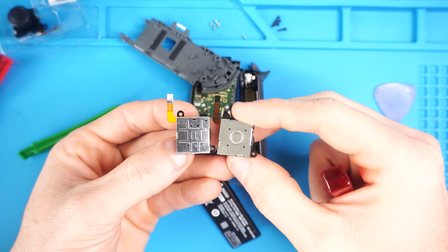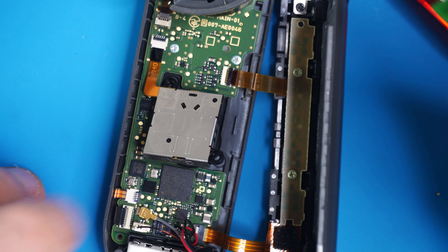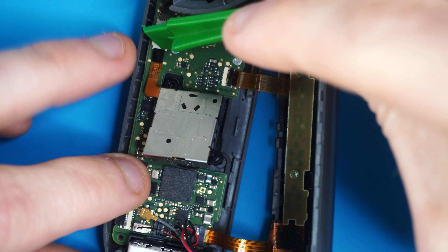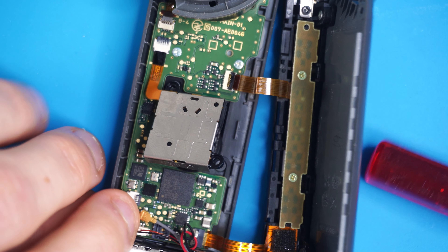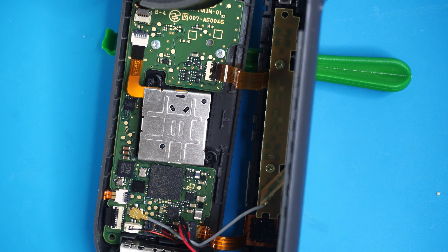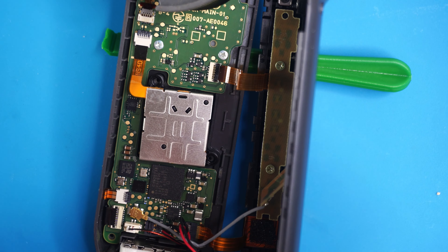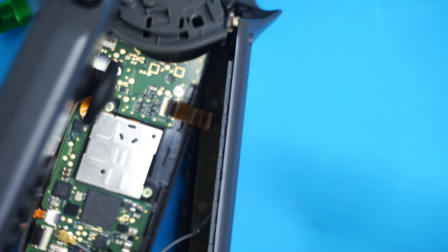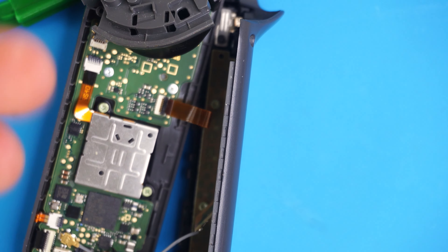Set it into the connector — there's really only one way that it can go. There's a little lip on it; push it into the connector and it doesn't go in very far — we're talking about two millimeters or so. Once it's in, push that black locking mechanism away from you to lock that ribbon cable in. Now lift the joystick up off the ground a little bit and gently place it through the little dust shield, then take two of those screws and your Phillips head screwdriver and screw it down into place, lifting the joystick slightly while screwing.